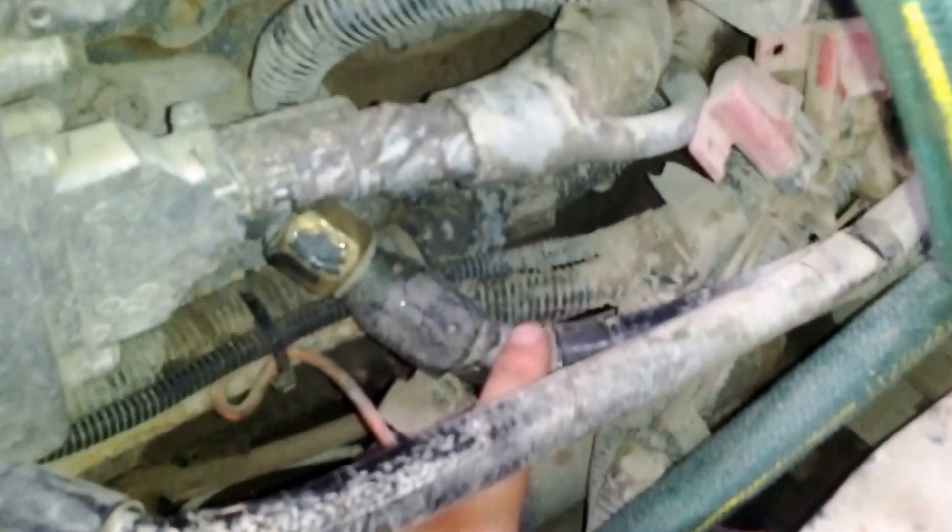Here is the main supply line going to the computer. In the back of the computer there's a heat exchanger, and it comes out right there. I took this valve out from right here. The reason I took it out — I'm going to show you what causes high pressure in your diesel filter. This line comes out of the computer, and there's another line that goes down, but I took it out because I bypassed everything. The truck would start but then stall and had no power.